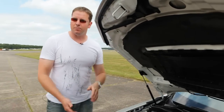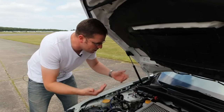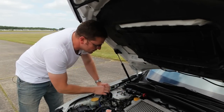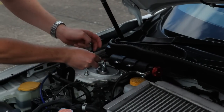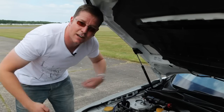It's the adjustability of MultiPro that makes it so easy to live with. Arrive at the track with a comfortable damper setting and when you get there, adjust whatever you need for the conditions on the day. We've got ten clicks of bump and seven clicks of rebound. I'm going to go four on bump and three on rebound. You can hear it, you can feel it — it's really easy, very positive, and once you've done it you're ready for track.